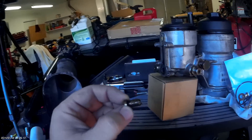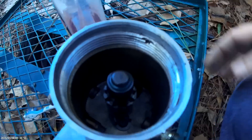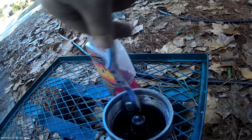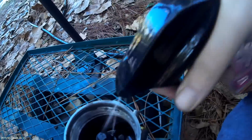So I'm going to clean all this out as best as I can — get in there and scrub all this clean and replace all this with new parts. I've got a ton of crud in here, so I'm going to clean this out with some engine degreaser or purple power since I've run out of brake parts cleaner. We're just going to get in here and scrub everything out as clean as we can and dry it as best as we can as well. You do not want oil or water heading to your injectors — it's always a recipe for disaster.